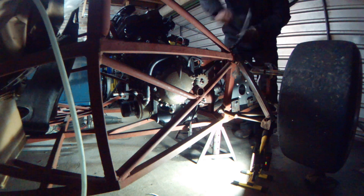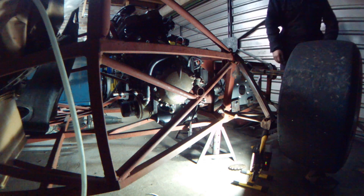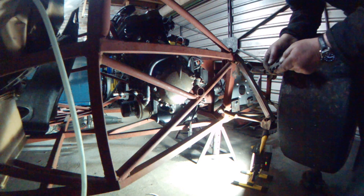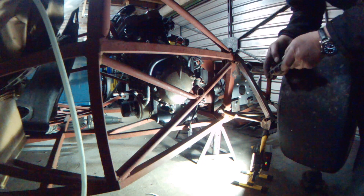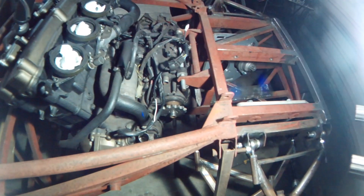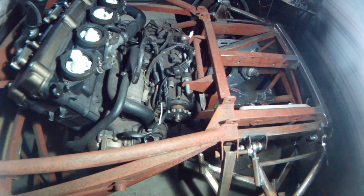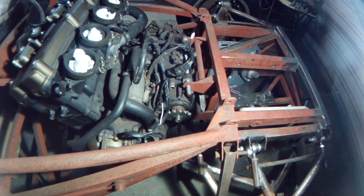Got the nut off. There should be a washer - a mop washer as well. The stuck sprocket came off. What size was that one? It was a 16. I'm going with a 15. Amazingly, the 15-tooth one slipped straight on, no bother at all. The one that was on it must have been slightly deformed because it did not want to come off, but that one just slipped straight on - didn't even need to hammer it.